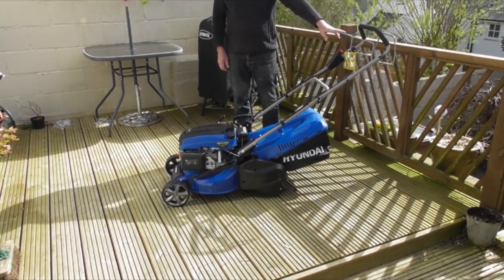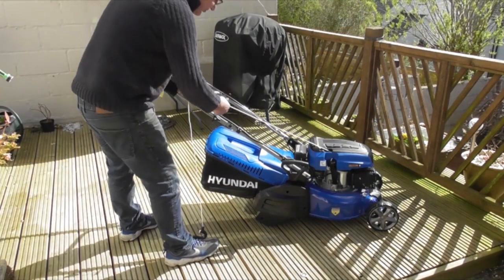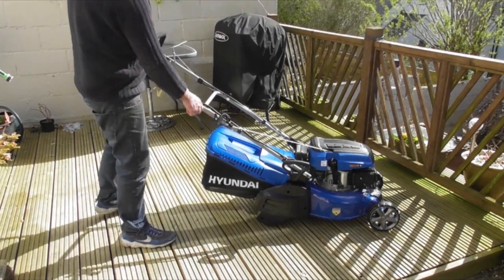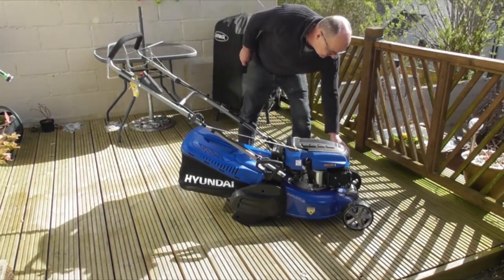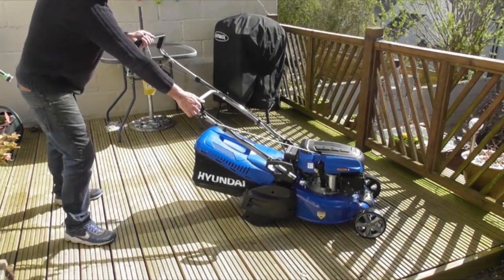And that's how to start your lawnmower. Should you have a flat battery, you can manually start the lawnmower. I've just pulled out the pull cord and tucked it around the little pigtail, which puts the pull start handle in a convenient position. It's fairly cold and hasn't run for very long, so I'll give it two pushes of the primer, pull back the OPC lever, and manually start the lawnmower.